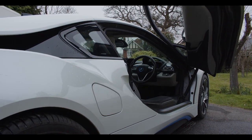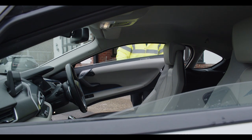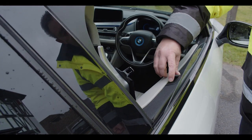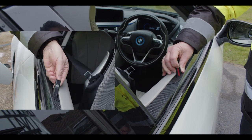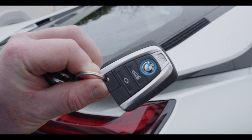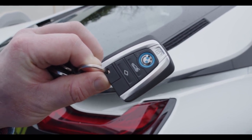To open the front door, try the outside handle. If accessible, you can try the inside door button. There is also a manual lever on the top of the door in line with the window — lift this up and slide the red toggle underneath to pop the door open. Access to the vehicle can also be gained using the key fob by clicking the unlock icon once.